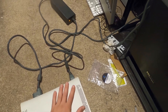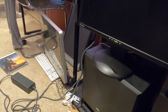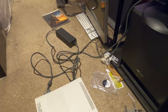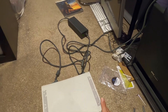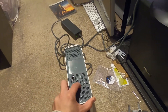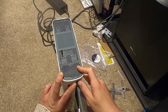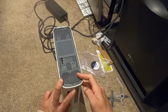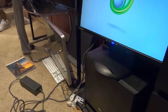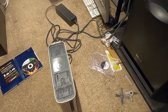We're not able to get past the splash screen, but yet we're further than we've ever been. For some reason it's freezing but we're not red ringing. We still have function of the CD drive. We could test the error code - holding down the sync button and pressing eject - but it's not giving us an error code because we don't have a red ring. We've almost got a logo.